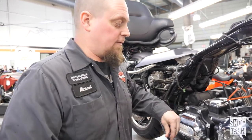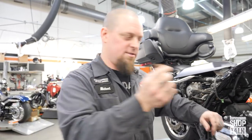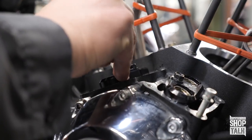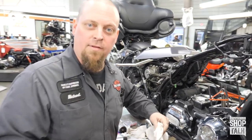You need two thousandths clearance on the sides of the lifter. I use feeler gauges and make sure I have two thousandths on both sides as I tighten it down, then tighten it to stock spec and put the caps on. Here's my trusty two-thousandths feeler gauge — nice fit all the way around. We'll put the tops on these and move on to the top end next.